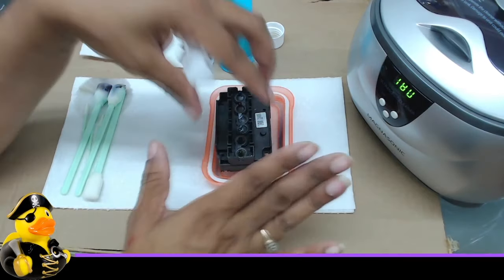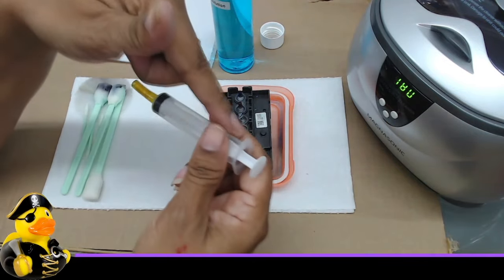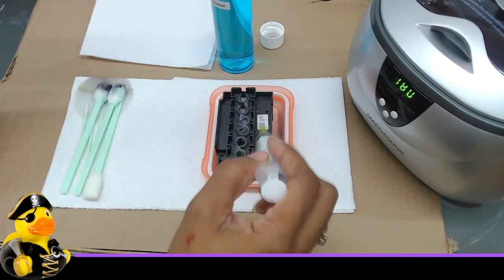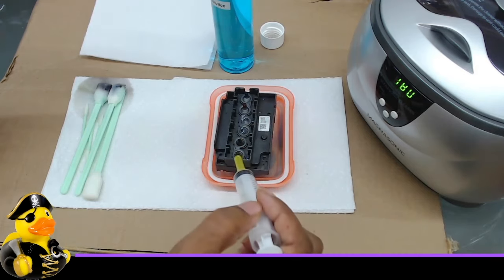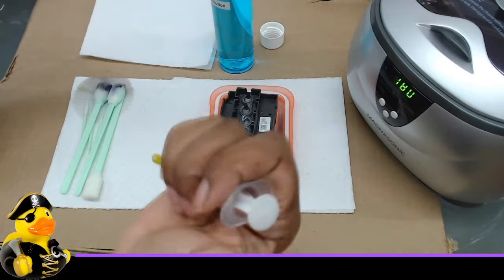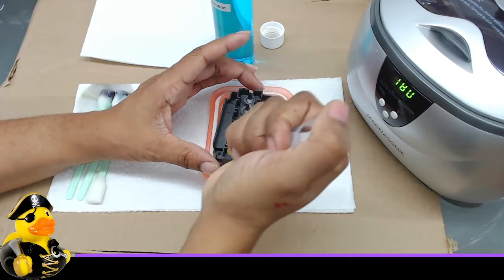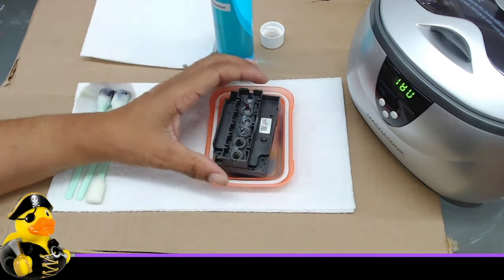You really have to be very careful doing this because too much pressure can blow the rubber gaskets that line the inside of this for each channel. Just like if you're blowing up a tire with too much pressure it will blow — likewise, the gasket will blow if you force the chemical out faster than the gasket can handle.